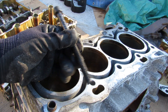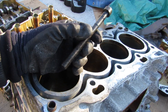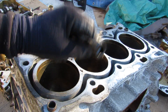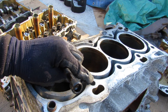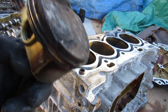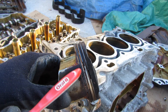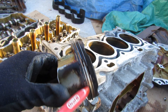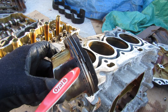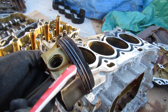One of the main problems with the predecessor to this engine — the 2AZ — was that it would strip head bolts right out of the aluminum block, giving the same symptoms as a blown head gasket, except the threads were actually stripped out requiring inserts or even an engine block replacement. Toyota has also addressed oil burning from the previous 2AZ motor, where insufficient oil return ports would get clogged and oil would end up inside the combustion chamber. Here you can see there are clearly four ports on each side and an improved oil control ring, and they've also reduced the oil weight to increase fuel economy.